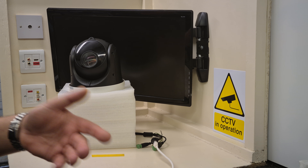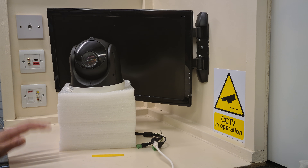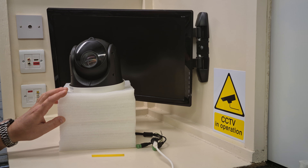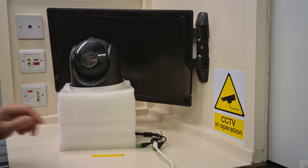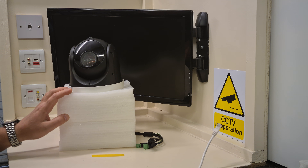So there it is, literally ready to go. If I go to the camera installation page on the network and press Add, this camera becomes immediately available to the Hikvision DVR and all its facilities are at our disposal — hence why all Hikvision DVRs now have the facility to add either one or two network cameras depending on whether they're the two or five megapixel variants.